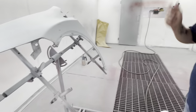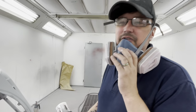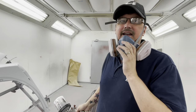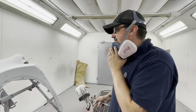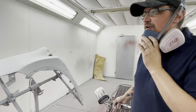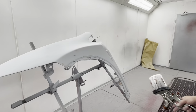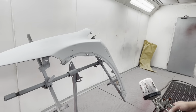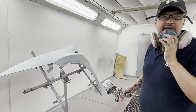So another coat of primer then. Is this a high build primer? Yeah, this is high build primer again, so this would be blocking and flattening down again. Which is why fiberglass is so time consuming, because of the amount of time you have to spend. Generally, you prime something, flat it, and then paint it. Well, it's someone's pride and joy, so they don't want those little holes in it. That's right. So we're priming it twice to make sure we get the best we possibly can.